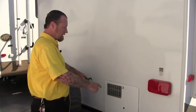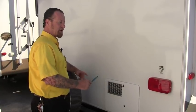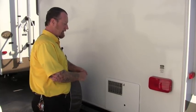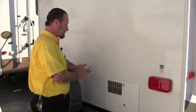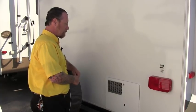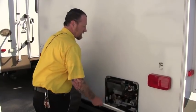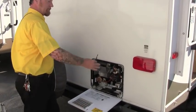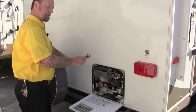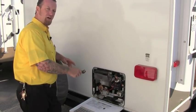Here we are at our hot water heater, and the first thing you want to do when you winterize your camper — after you've got all the proper tools — is empty all the tanks. We want to empty the fresh water tank, the black water tank, the galley and gray tanks, and most importantly our hot water heater tank. This one happens to be the Atwood with the plastic plug so we're going to use our channel locks. One very important thing before you empty your hot water tank: if you've got an electric hot water heater element, make sure that device is shut off.